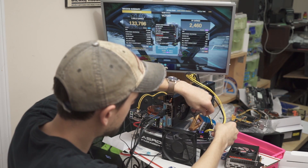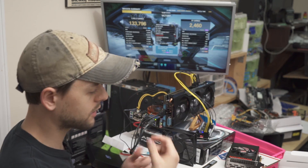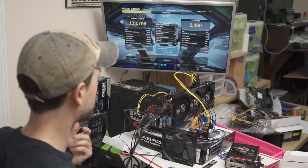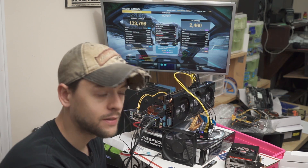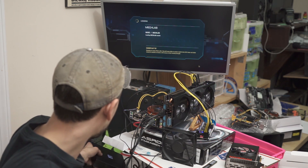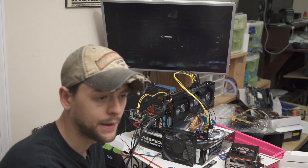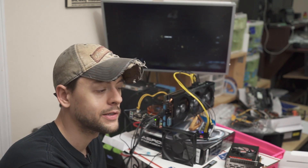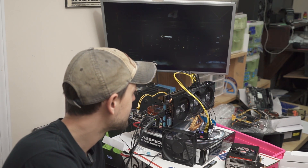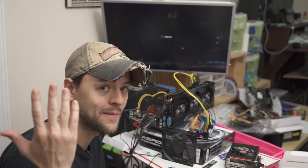I jumped the HD Plex, so you don't have to use a bunch of wires if you want to do that. It's real simple — you just find the green wire on the power braid and the black wire and connect a wire between the two. The system runs great, so if you want to use a dual-brick setup, go for it. But again, I would probably use a single big industrial brick and wire it up. I don't know how much this video helps you, but if you thought it was fun, great — and if not, you guys asked for it. Peace.